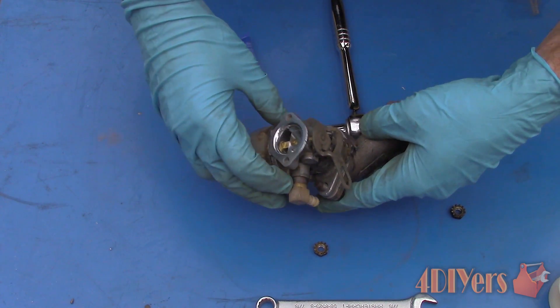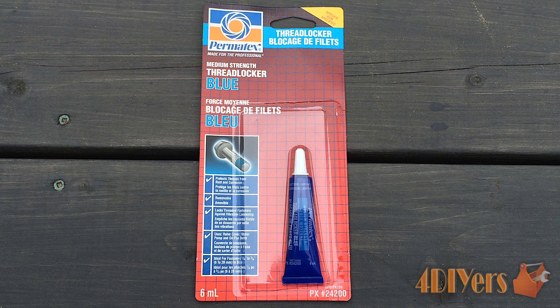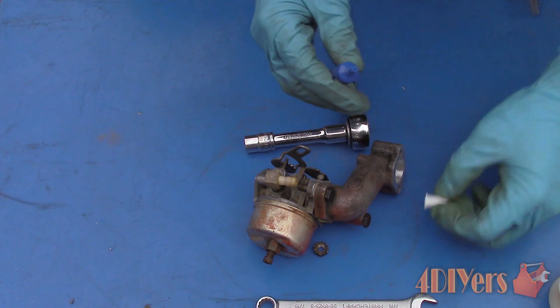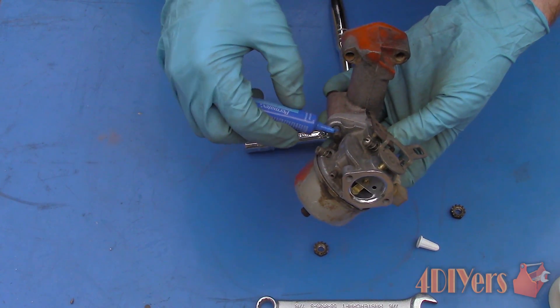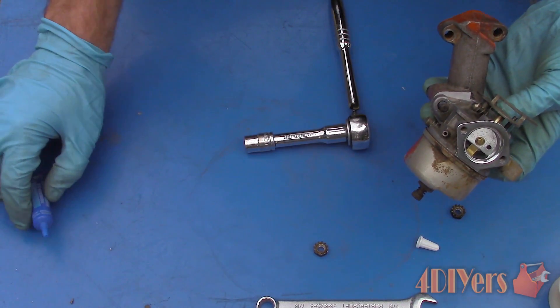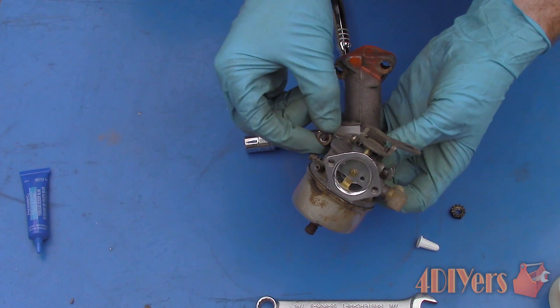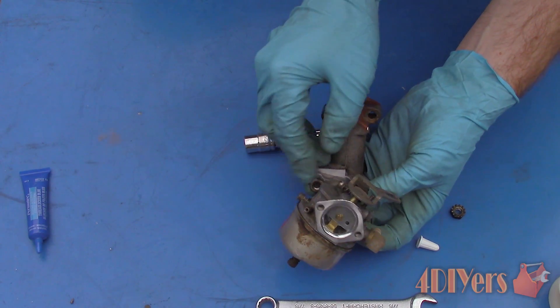When reinstalling the carburetor back onto the intake manifold, I'll be using a blue medium-strength thread locker made by Permatex. This is a small engine and will suffer from vibrations, so this will reduce the risk of the bolt loosening up over time. This product also protects the threads from corrosion and can be removed easily afterwards using hand tools. Beyond cleaning the carburetor, I have also polished and ported — if you are interested in a tutorial on that, I will include the link in the description below once it is released.